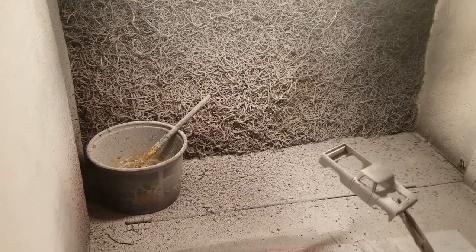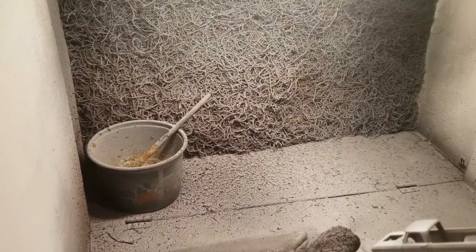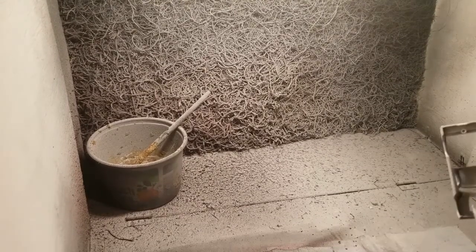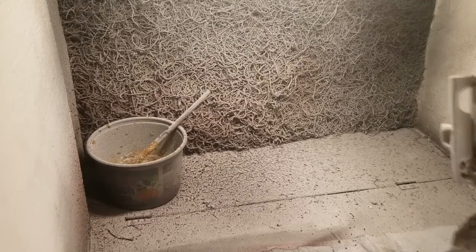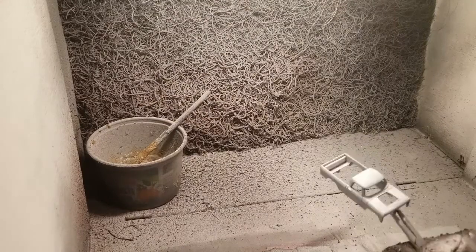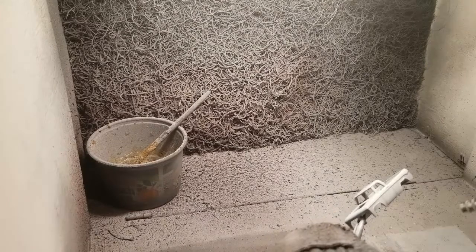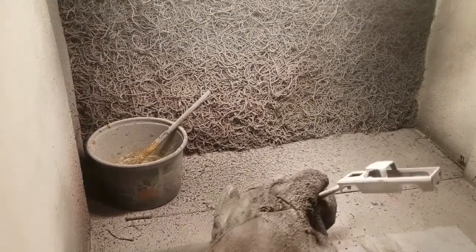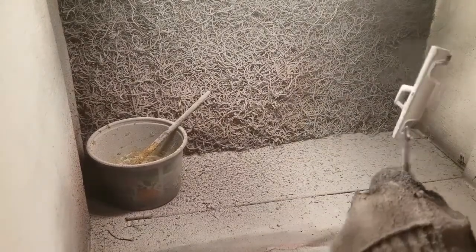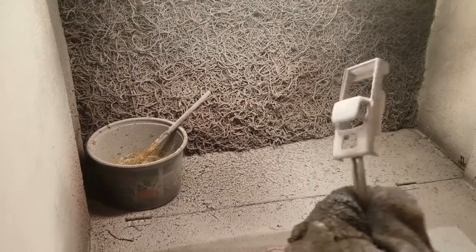Autoborn sealer goes on really nice. If you read the bottle, it does say around 25 to 30 psi, which does seem to work about the best. I like it around 30. Every once in a while I do have dry tip issues. I'm still kind of getting used to that and trying to eliminate it, but definitely the higher my psi, I've found that the dry tip comes out a lot more. So right around 30 max, 25 to 30 definitely seems to have the best flow, and it doesn't have the dry tip going on.